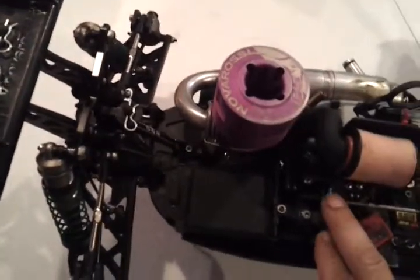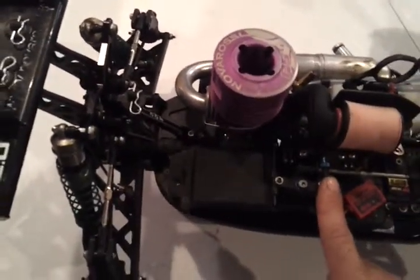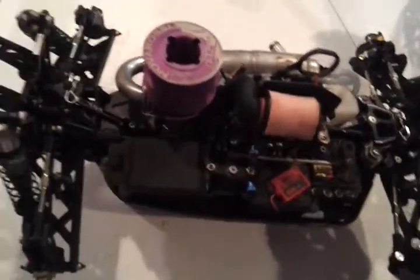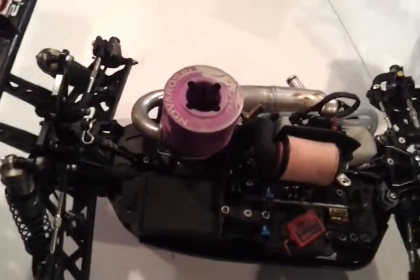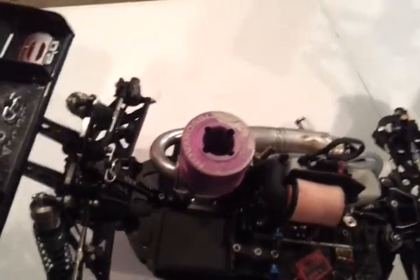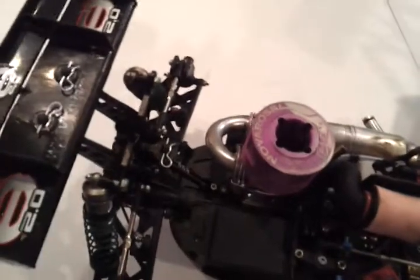You've got to make sure your brake linkage is set up pretty good because if you've got full-on brake, this is going to lock up like crazy. You want to run higher rear brake grab than your front so that when you're braking, you can still steer. If you get it set up just right, you can really whip these things around the corners — that helps out tremendously.